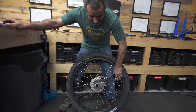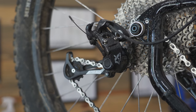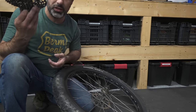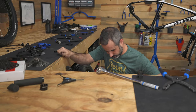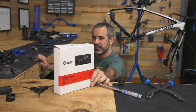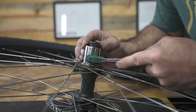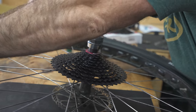We just ran into a little snag. I assumed, because this bike came with a SRAM drivetrain, that there was a SRAM cassette on there, but that's not the case — this is a Shimano type cassette. It's made to fit on a Shimano driver body, and we just can't install this on there. So I need an 11-speed cassette. Parts bin. I have a 46-tooth 11-speed cassette that'll fit. This 46-tooth is still bigger than the cassette he had, and he's still going to get this derailleur. Having a parts bin is nice, and my time with Box — they supplied a lot of parts, and they're going to good homes now.